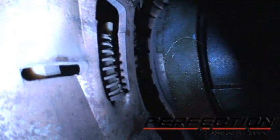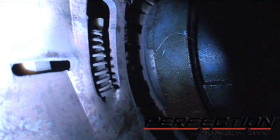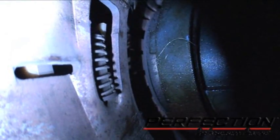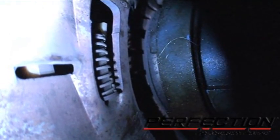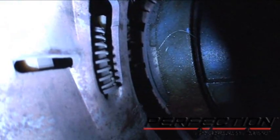This is a self-adjusting clutch, and the length of that adjustment spring — you see how it's almost all the way to the tip — that's a pretty good indicator that this system is thin, almost down to the end of its service life.